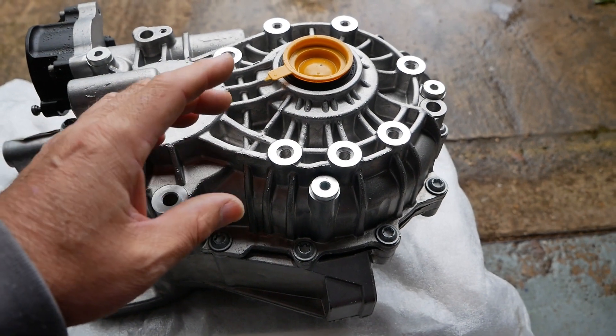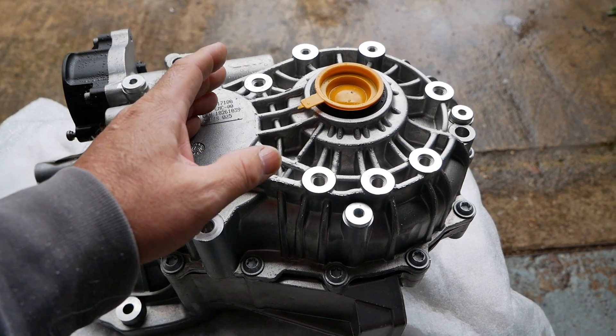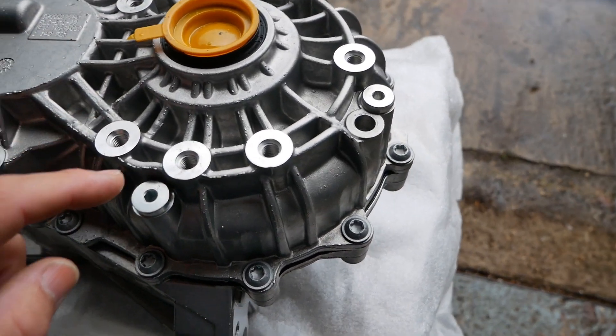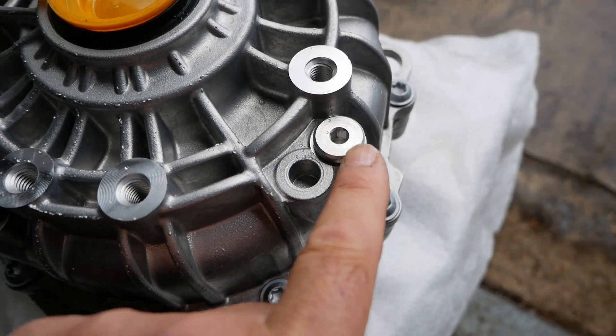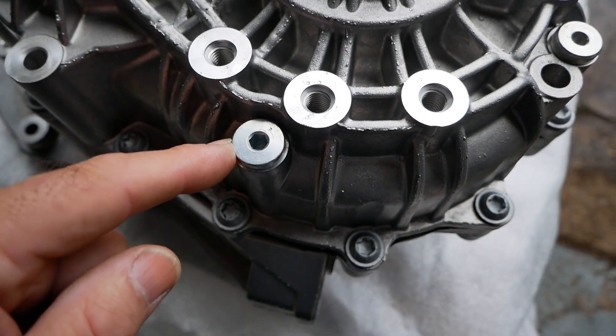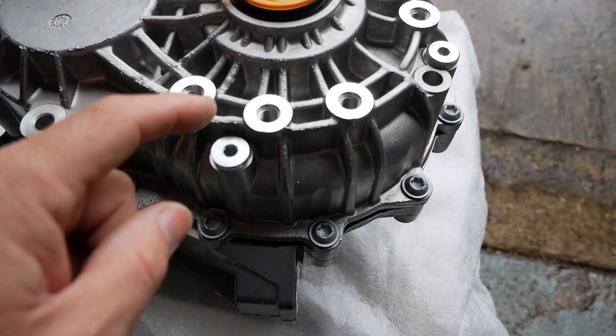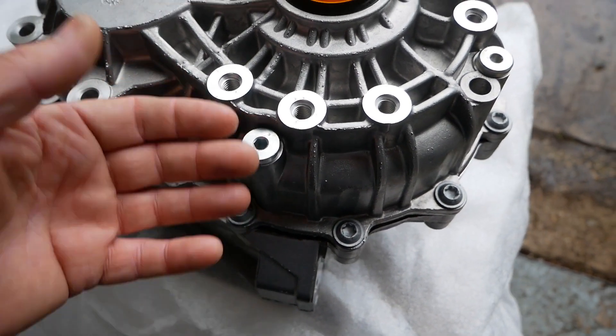It's just beneficial to have nice clean oil. When these are mounted in the vehicle, it's not clear where the oil fill and drain plugs are. In fact, I've looked at these many times in the vehicle and just assumed they don't have plugs and are sealed for life — however, they are here. This is your drain plug and this is your fill plug, and they've got an allen key head on them.